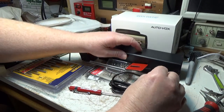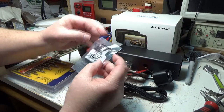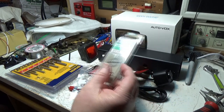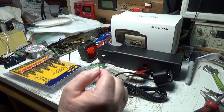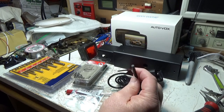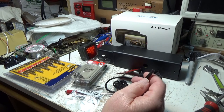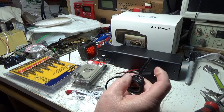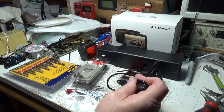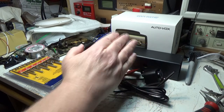I've got some number 4-40 and 6-32 screws here — I might use the 6-32s since I only want to put one in, and I've got some blue Loctite to lock them in. I also have some number 6 lock washers. It's all stainless so it won't rust and will be easy to remove. My concern is protecting the connector on the rest of the harness — I'm thinking dielectric grease and then heat shrink over it, since these electrical connections weren't designed to be out in the weather.